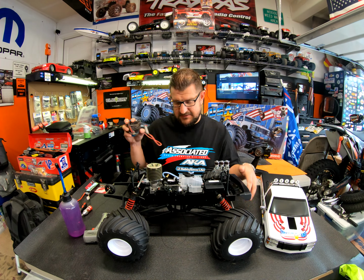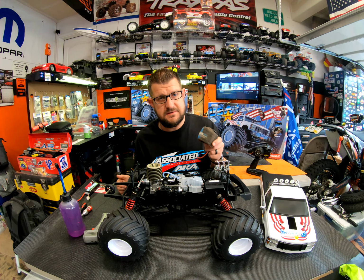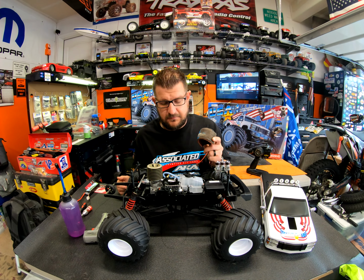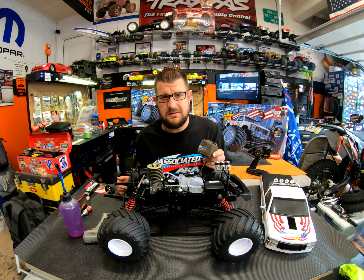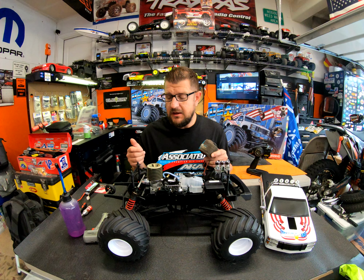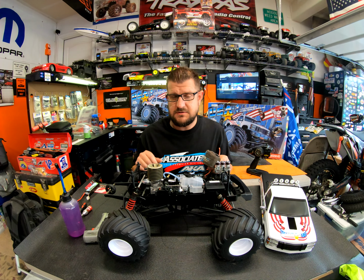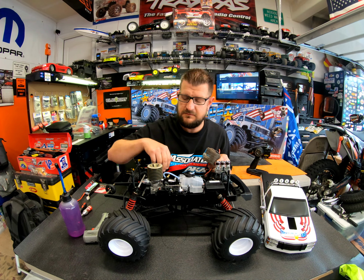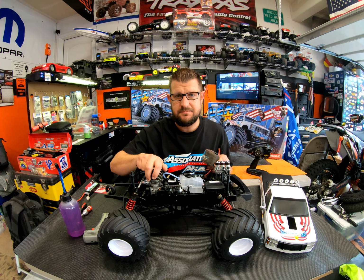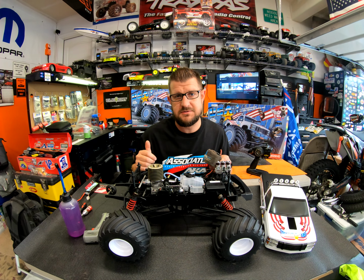Touching on more on that topic, you either want a heat gun or a cylinder head heater. I use this for racing, so that's what I'm going to use today. It's a lot more handy than a heat gun. But anyway, either a heat gun or a cylinder head heater. If you're using a heat gun, before you start the engine, you just want to hover the heat gun over the cylinder head. You want to get the crankcase on both sides. You want to get this engine up as close to operating temp as you can with the heat gun before you ever even try to start it.